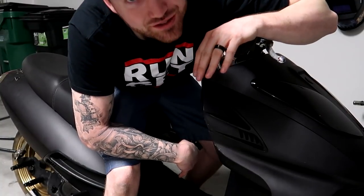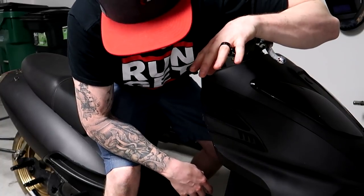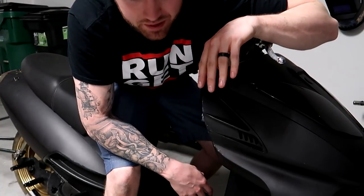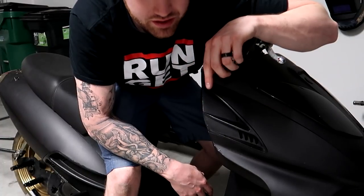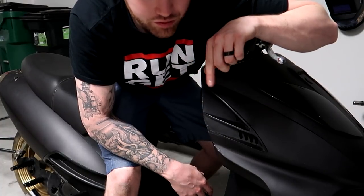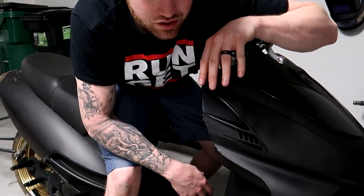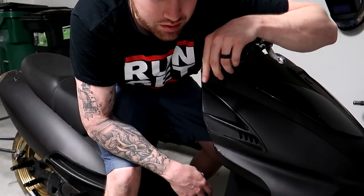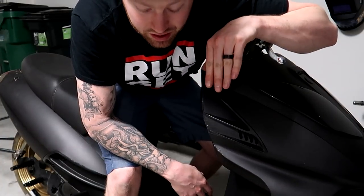I've been sweating, I'm bleeding, I cut myself open. What's been happening is I had a fuel issue where too much fuel was going into the carburetor because it's gravity fed, and it was overflowing the carburetor. It went into the motor itself, so I had to drain all the engine oil out, turn the bike over with the spark plug out to get anything out of the cylinder. It should be clear to go.